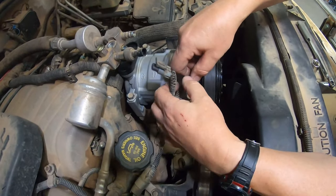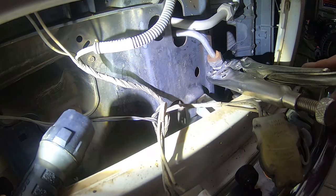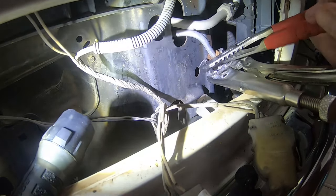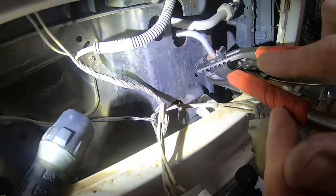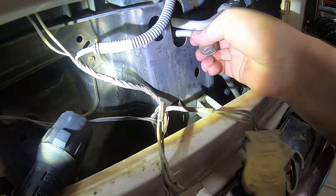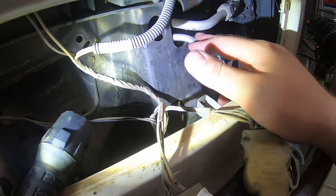Now you've got to put your electrical connectors back in. For your orifice tube, it's going to be down here in this lower pipe. We took this headlamp assembly out so it was easier — the grill stays in. Get your vice grips on that lower nut so you don't break anything. Grab your channel locks or whatever you have. Just break it loose. Cramped spaces, big tools, slow going, but it's worth doing. Hopefully you have enough room to pull it apart. Fantastic. Now with the line nut off, getting that orifice tube out is going to be a little interesting, but I think we're doable.